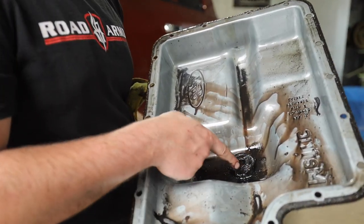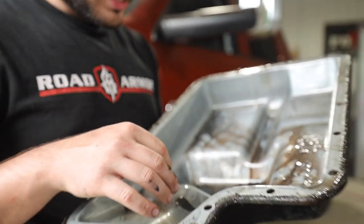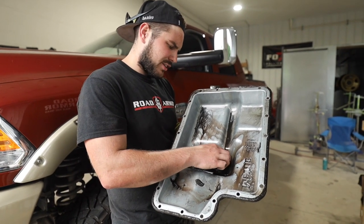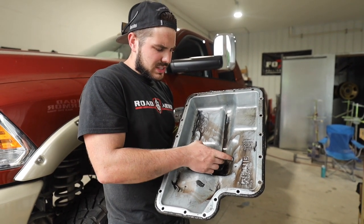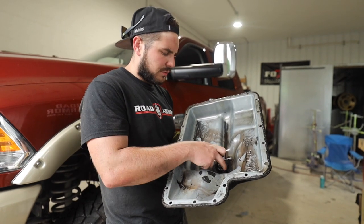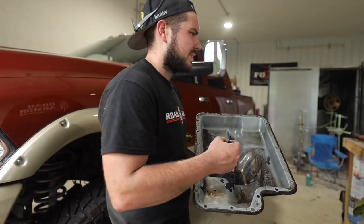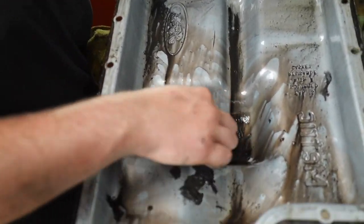Don't mind the asphalt chippings, but this is about all the sludge that was on this magnet. I'm gonna go on a limb — that's just normal material. Nothing excessive, nothing crazy. There's not really any metal shavings — just that clutch friction material that comes off naturally. I wouldn't say the tranny itself is super smoked, because if this is all that's come off in 274,000 miles, even if the fluid was only changed in the last hundred thousand, I don't think this is abnormal. I also found another check ball attached to the magnet.